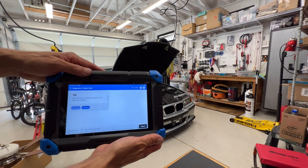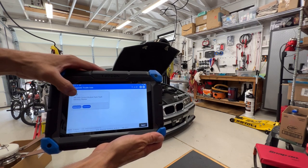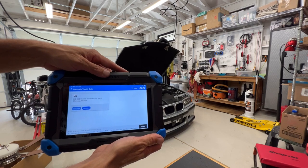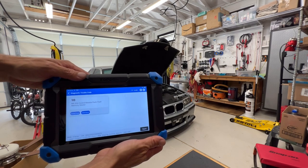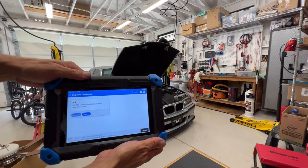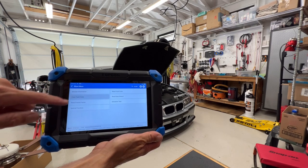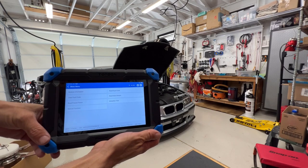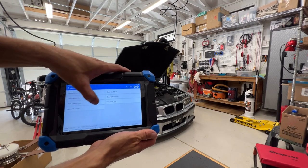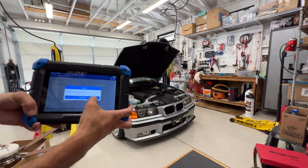Okay, just giving you the info of that, which I don't really know what it's for. Read fault code. Control module fault memory master. Maybe because I unplugged that cap while it was running. I started it up right before my camera was on, so I turned it off and redid it for you guys. We'll just clear that because I think I induced it. Read it again, no fault code. Okay, special function, clear adaptations, yes. Turn engine off.